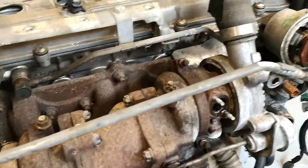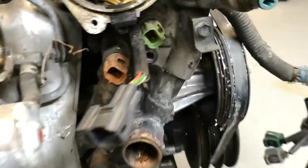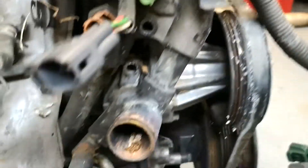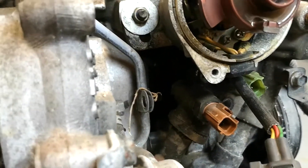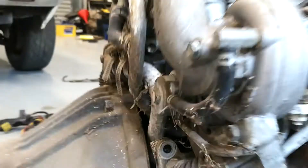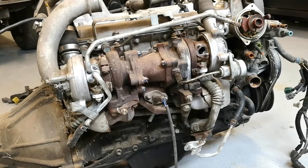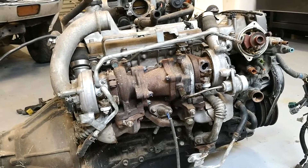What I'm aiming to do is take those turbos off — that's one of the reasons I pulled the engine out, because it was so complex trying to get to the bolts. This is where the thermostat sits, and if you follow that down there's a series of water lines coming off it. There's a little bolt up in behind attaching to that line that's stopping me getting it off, and those lines run all around underneath. I reckon once those turbos are off and a single turbo manifold is on, a lot of those lines become redundant, making it much simpler.